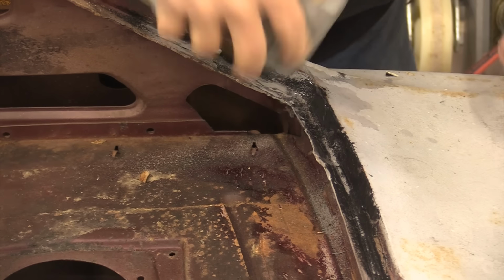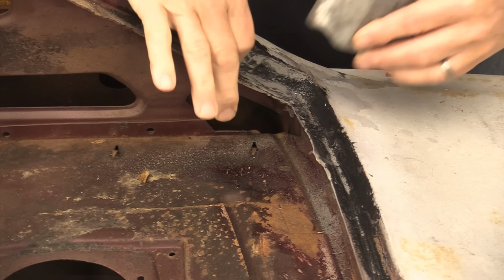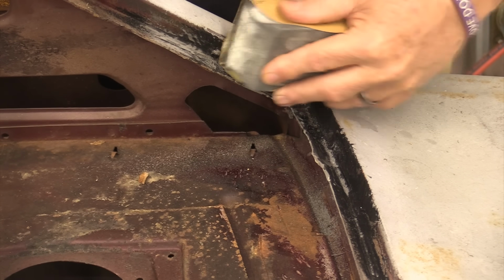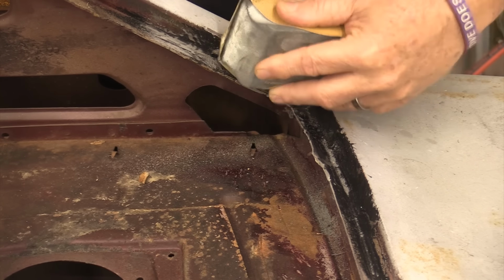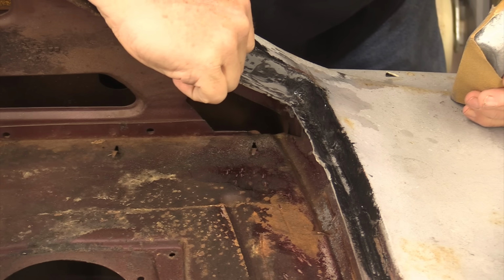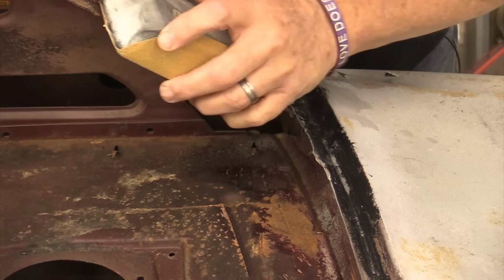And this line right here, I'm working this. It's really tight because we've got these pins in here for the rear window moldings. And those are, let's just say they're in the way of any really dramatic sanding I would do. And I am going to have to work this pin with picks and tools so that it lays the way I need it to, because this pin has got junk all around it from me putting the adhesive on there, and it's going to need to be cleared in order for the clip to sit in it.